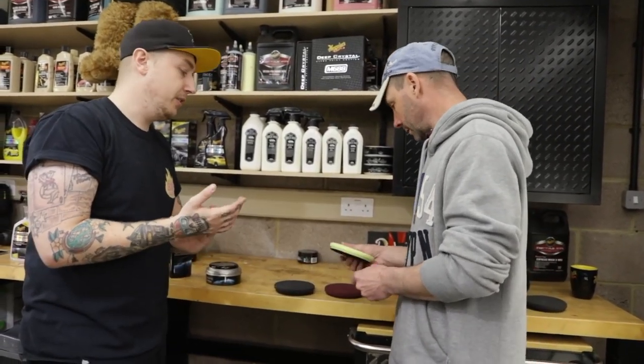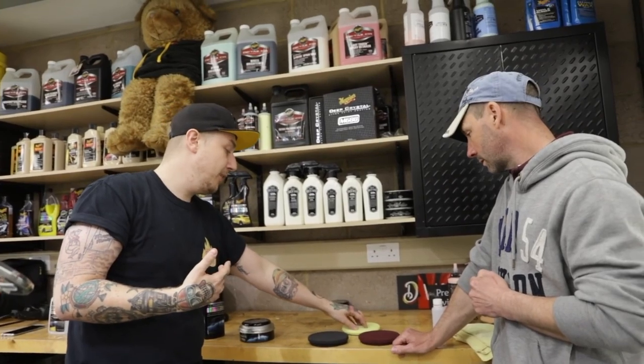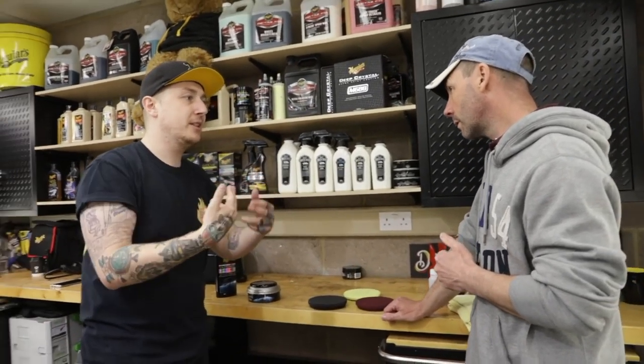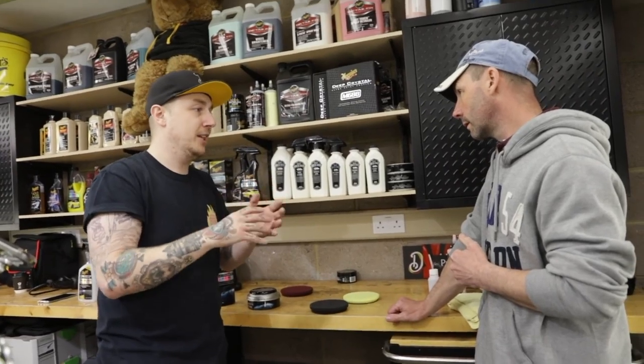Right, okay. Yeah, so any kind of mid-range refining tool, whether it's like 205 or 210 or ultimate polish, would be great with that. Or if you've already taken the hard swirls and scratches out and you want to maintain it, you can maybe use ultimate compound with that if it's swirled but not heavily swirled. Yeah. So it's just adapting it to the paint.